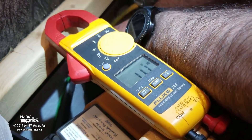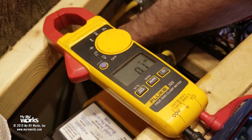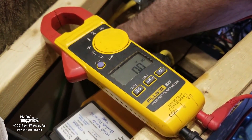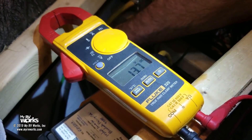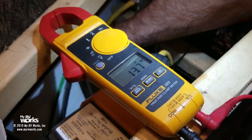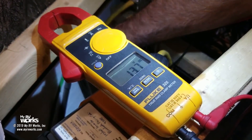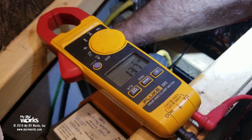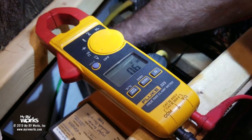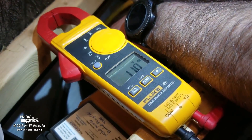What I'm going to do is keep my red lead on the fuse. There's my 13.6 again — now 13.7. The reason I've got 13.7 is because I'm referencing the negative on my converter. I know my fuse is good, but when I reference the frame I get that 11 volts. So what's up with that?